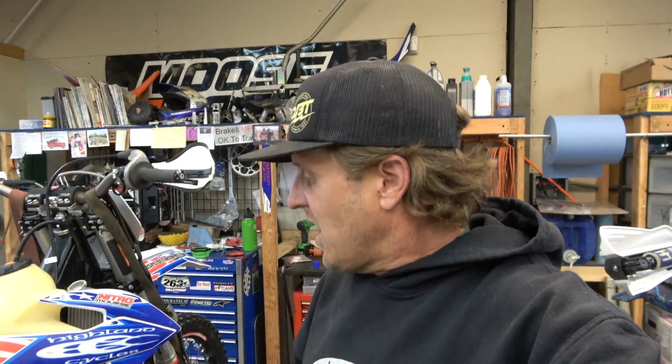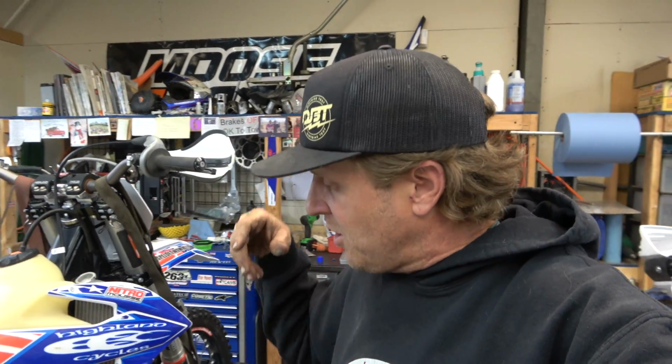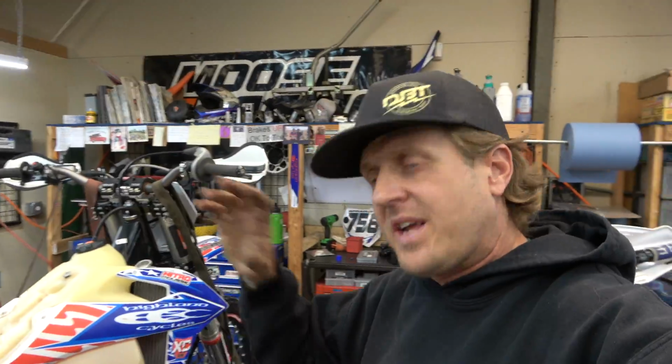Maybe you heard as I first fired it up, it's kind of burr, burr, burr. Well, that's because of that assembly lube and all that other stuff. Also, probably because the power valve was kind of a little bit hung open. It needed to warm up and shake and then go back to its home. So it takes a little bit to burn all that stuff out of there, get everything loosened up. So there we go.